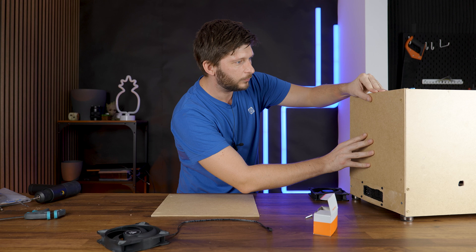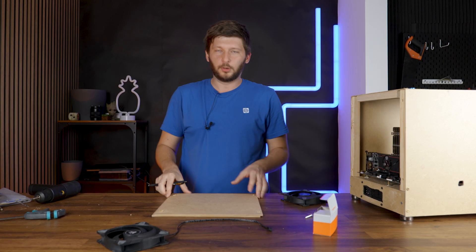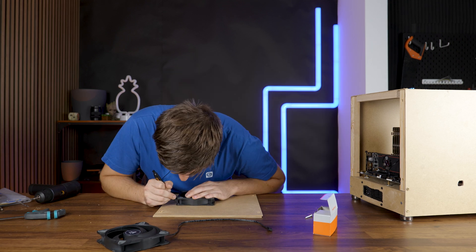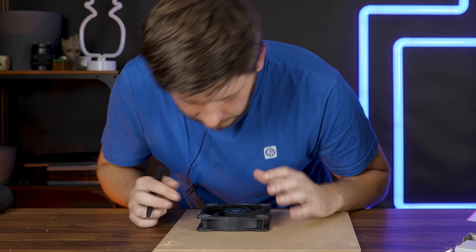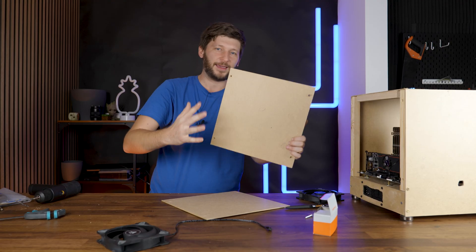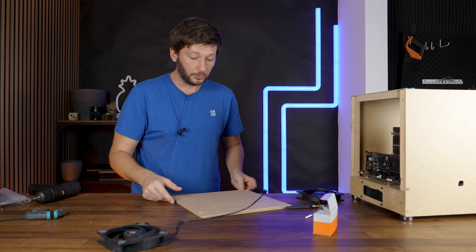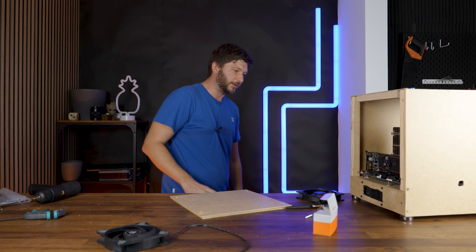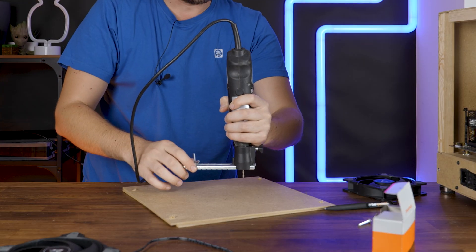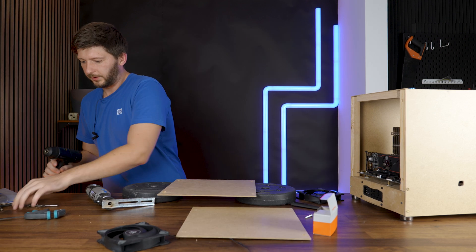This is not going to be an exact science measurement-wise. I'll decide on one position and go with that one. I have a pen — this is the center of the 120mm form factor. I'll also mark where the screw holes are, indicating the areas I cannot touch in order to ensure the mounting stays intact and the fan doesn't fall out. To cut these holes as circular as possible, the Dremel comes back — I love this thing. But before I can use it, I actually need a starter hole to go through, so let's drill that first.